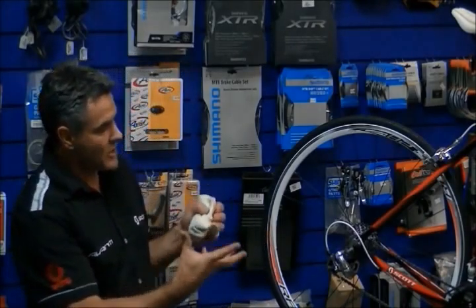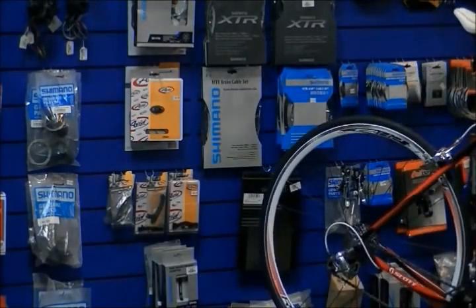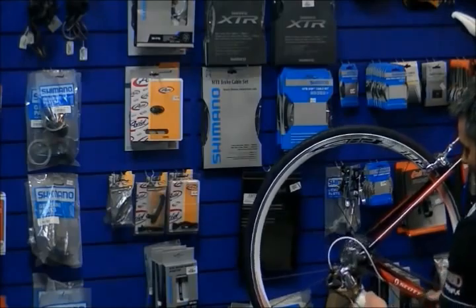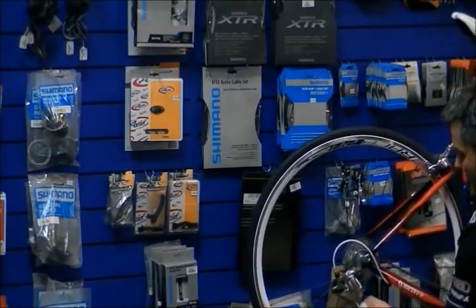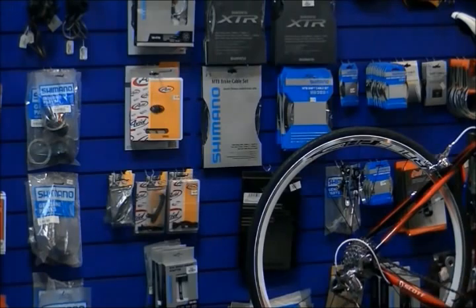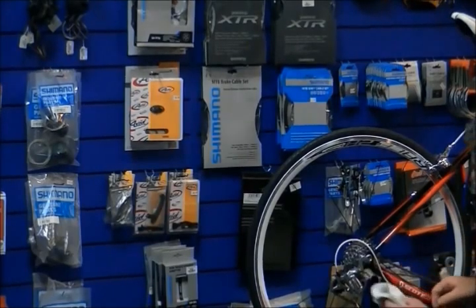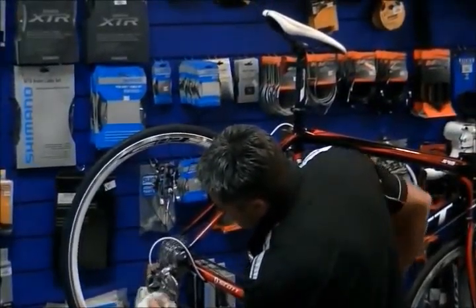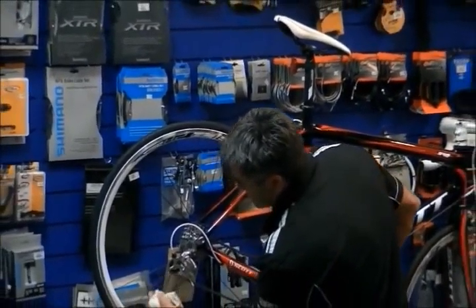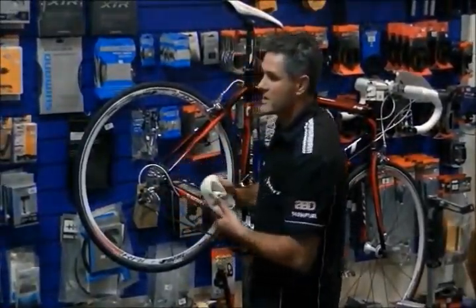Come to your bike when it's in pretty clean condition. With a rag, get someone to hold your bike or lean it up, put a rag around your chain and run it backwards to clean off the excess. On a brand new chain it'll come off fairly clean, but if it's had lubricant on it and been ridden for a few rides, you'll get that black, dusty residue. Give the chain a general wipe, then wipe around your pulleys — spin them backwards while holding on and that'll get all the muck off. Even the cogs, a little rub — get as much off as possible.